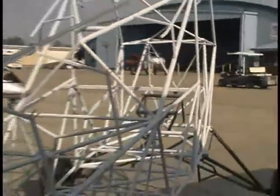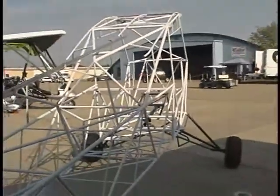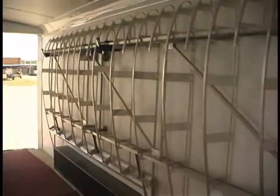Is the wing the standard type that Cub used 30 or 40 years ago? It's traditional design. We use all-aluminum ribs — the ribs we're using are a PMA-type rib with an intercostal brace, very light and very strong. We're using carbon fiber leading edges, which allowed us to eliminate the nose ribs and save a couple pounds. We're using a carbon fiber wing tip as well, and the all-aluminum base makes for a very sturdy, lightweight wing.